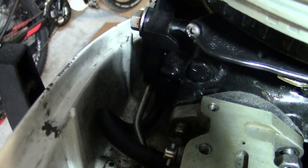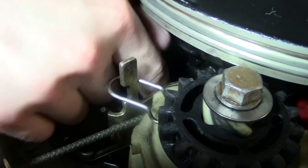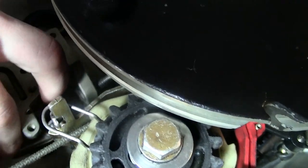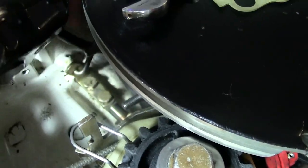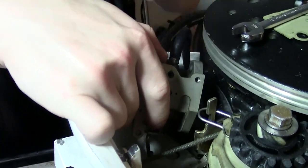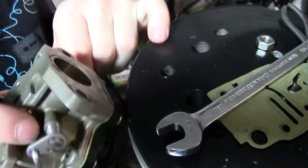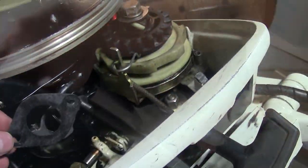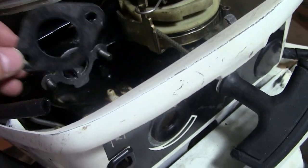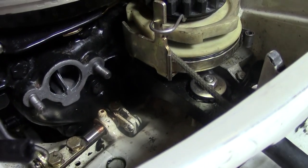I had to take two hands, putting a fingertip on each hand, and kind of wiggle the nut off the tight side. That way we were able to get the carburetor off. Then disconnect the fuel line — pull it off the little fitting coming off the carb. You'll also notice the main carburetor manifold gasket on those two studs — take that off carefully.